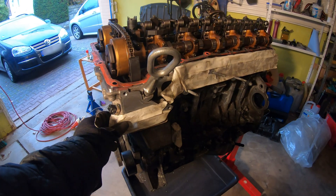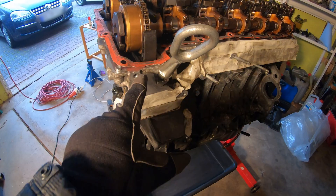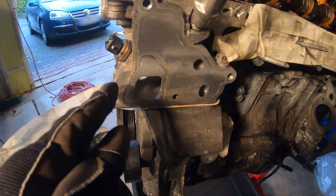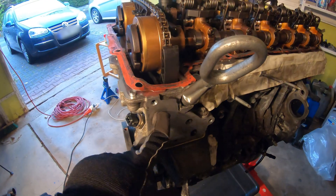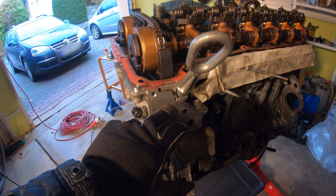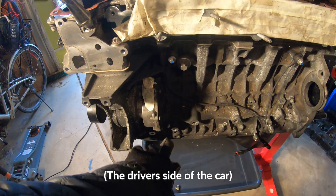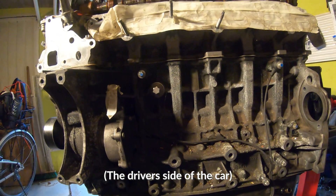Moving around to the right side of the block, there is your oil cooler with your little oil filter on it. It has a double gasket on the inside. Water gets pumped through here and oil gets pumped through the same unit to cool the oil. Normally these go bad and you end up getting milkshake in your engine — you might think your head gasket is bad, so always check this first. This will leak down the side of the block onto your vacuum pump. If you don't know where your oil is coming from, check the oil cooler.